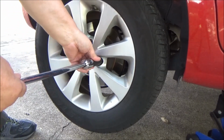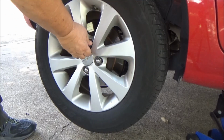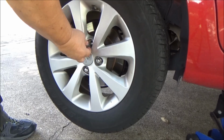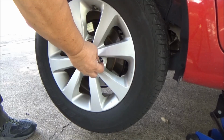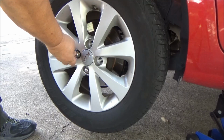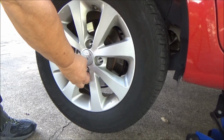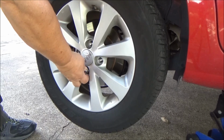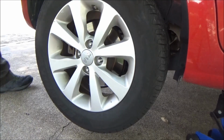And then when I started driving, my low pressure light came on, and I thought, oh wow, good timing to get that spare, because now I've got a tire with low pressure. But I checked all the tires and they were all fine, and then it occurred to me that since I got the spare off of a Kia, maybe the sensor in the spare was detecting. Sure enough, the spare was low. I put the air in it, and the light went away. So that's pretty interesting that the system will detect even if your spare tire is low, which is probably a good thing. You want to know that you're driving around with a good spare.